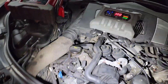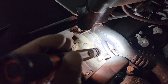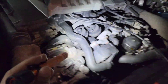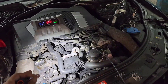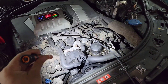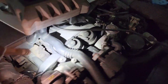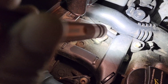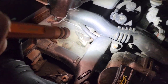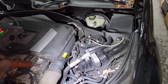So I checked — there is a fuel port right here, right here as we can see, under the right side. Standing in front of the car, on the left side, right under the secondary air injection hose, there is a valve. You can press on it to see if fuel comes out or not when the car is cranking. The engine is trying to crank, but there was no fuel coming out.